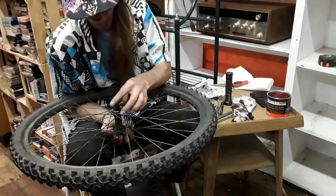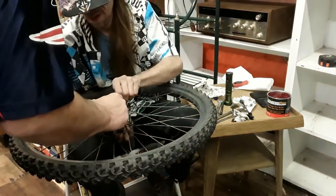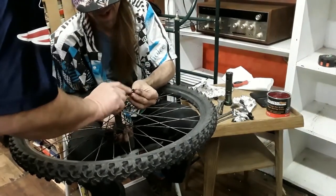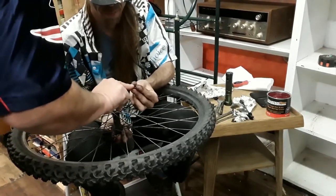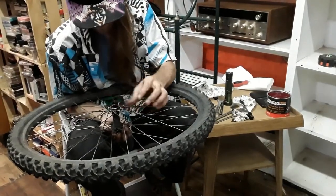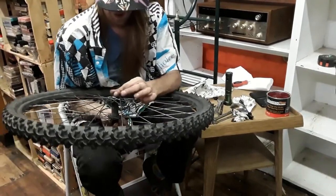Yeah. I was thinking truthfully, we could probably put a little bit of that wheel bearing grease in there, underneath the ring right here, see? I'll come back and show a little bit of what I was thinking right there. You know what I mean? So it's on the right top. Right inside that groove. Yeah, why not? It's not gonna hurt anything. There we go. That's beautiful. That's so that we're not dry up there. The other side should probably be done the same. We'll get there.